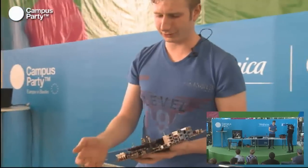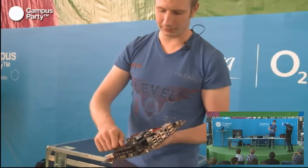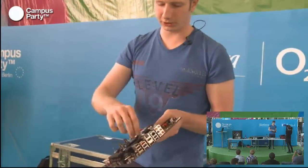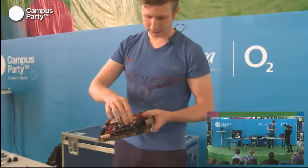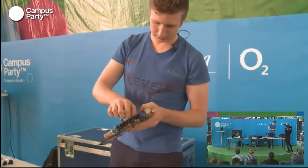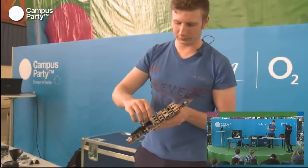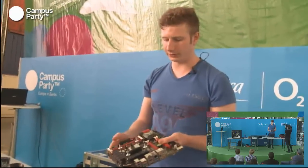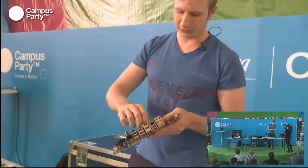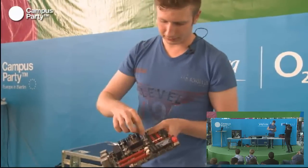And try to count in your head that you're turning like 5 times around each time, because then you'll know how much each screw has gotten. There isn't any golden rule of how much you can turn it down to. But if you apply too much pressure on it, then certain CPUs won't start because they're having too much pressure. But that's not a problem with very many.